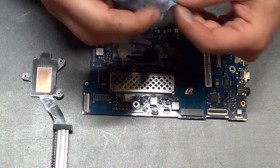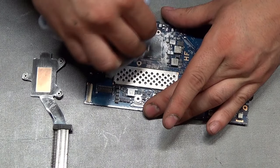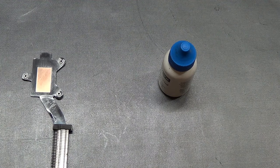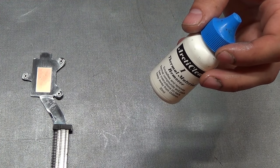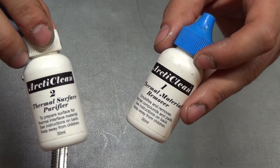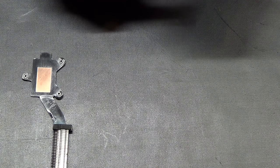We don't really need to clean the old motherboard off, just clean it off a little bit so it doesn't make any messes. Don't go crazy on cleaning it — it has little components right next to the CPU and GPU, and if your paper towel or fabric towel gets caught on one of those, it just rips right out. You want to use some kind of thermal paste cleaner. This is Arctic Clean — Arctic Silver. The company that makes Arctic Silver also makes these two: thermal paste remover and thermal surface purifier. They work really well — they make it really easy to clean the old thermal paste off.